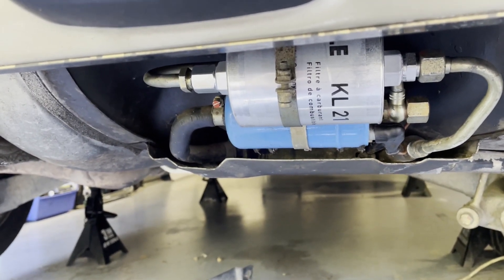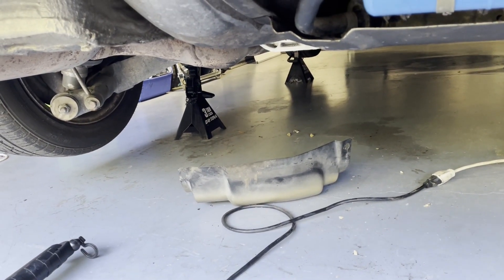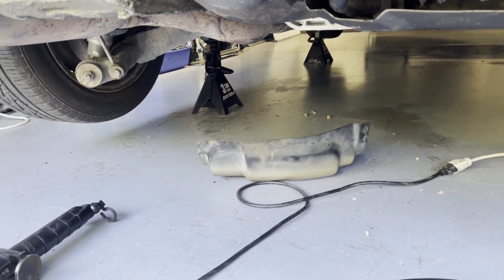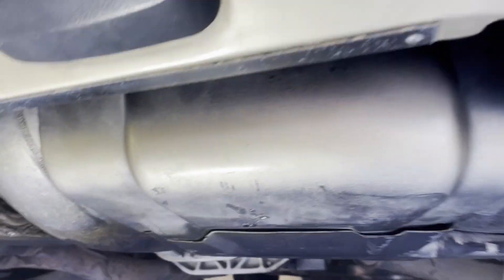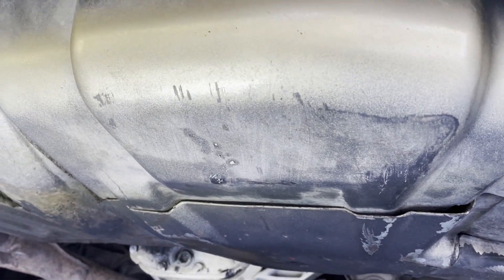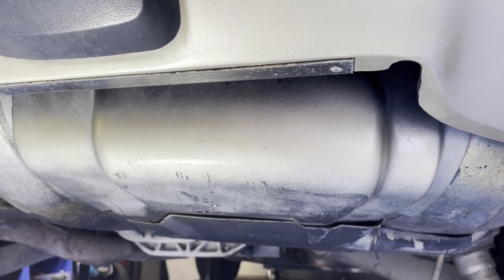So that's done. Now I'll put that piece of metal right there back on with those two nuts and we'll be all complete with the fuel filter. There's a 10 millimeter bolt there — that's what you've got to attach. And there's one more over here on this side, it's harder to see but it's up in there. The front side just slides up underneath the black piece there, so once that's in there it holds it in place. There we go — job done. Fuel filter changed, and on to the next.